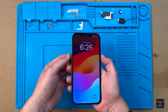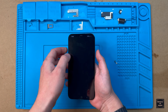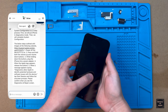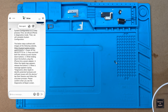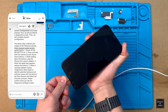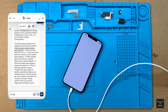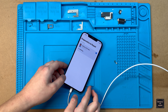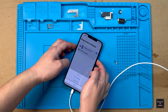The next course of action is to get the parts configured. I have to contact Spot, which is the company that runs the self-repair program, and provide them with the iPhone serial number along with the order number. Spot's directions tell me to boot the iPhone into diagnostics mode, which is required to configure the parts correctly. Now that Spot says it has completed, we can go ahead and end the testing, then boot the iPhone out of diagnostics mode.